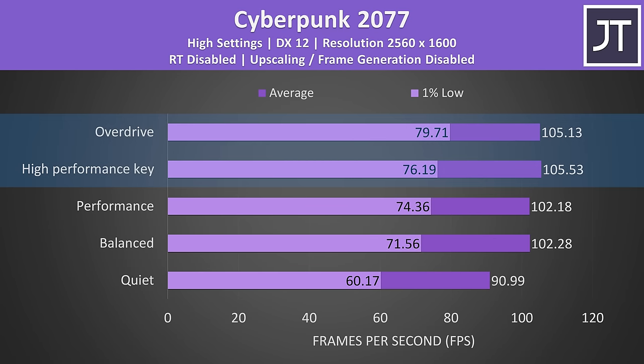The total system latency — the time between a mouse click and when a gunshot appears on screen in Counter-Strike 2 — puts the M18 R2 as one of the fastest results we've measured so far, close to other high-end 18 inch laptops. The M18 has a MUX switch, but it's a little hidden in the software and needs a reboot, so you'd be better off using Advanced Optimus through the Nvidia control panel, as that does not need a reboot. G-Sync is available when Optimus is off, and Adaptive Sync when Optimus is on. There's a 1080p camera above the screen with IR for Windows Hello face unlock.